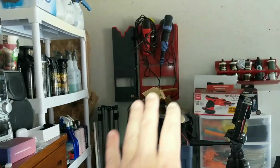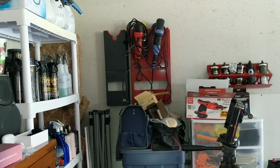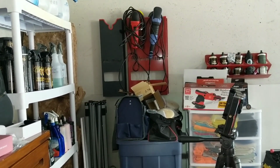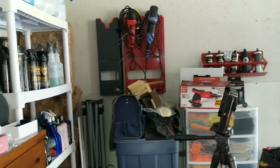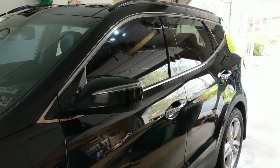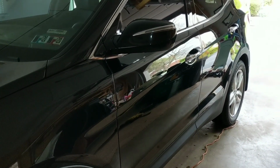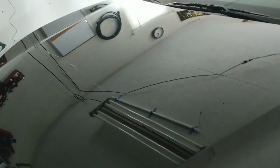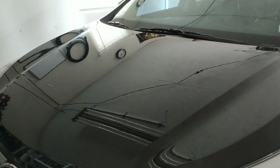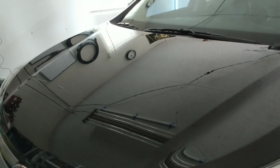But I'll be honest with you, because I'm so familiar with these 2 polishers right here, 9 times out of 10, they get a majority of the defects out. A majority of my customers are probably soft to medium paint. I don't get a whole lot of hard paint in, like your Mercedes-Benz, your Corvettes, things like that. I get a lot of daily drivers. This Hyundai Santa Fe is a repeat customer. I have polished this vehicle before, so I know it's precariously hard. And the customer is specifically wanting QPON 2.0 put on the vehicle. I offer a package where I use Enigma All-in-One, which is a medium cut compound that finishes down beautifully.